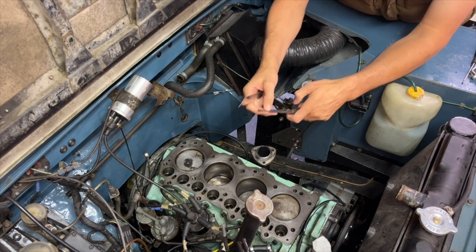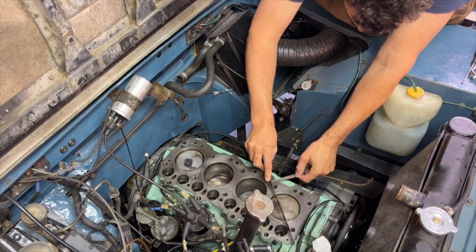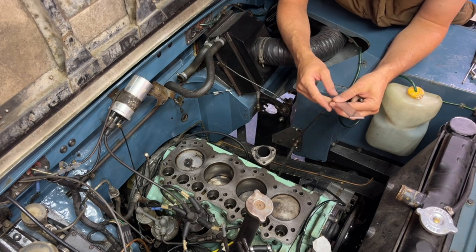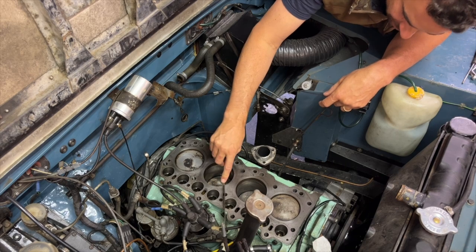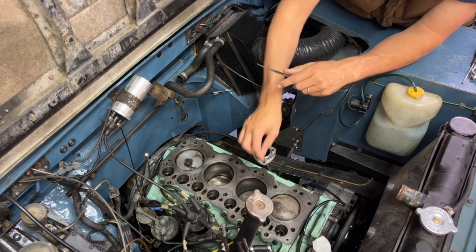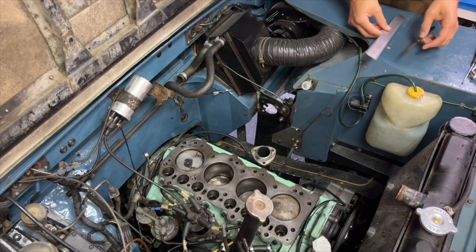And basically what I'm going to do is go along diagonally like this and check here for any warpage. I don't know what the tolerance is on this engine, so I guess that would be quite useful to know. I did just Google it, but I didn't find anything. But there will obviously be a tolerance on the cylinder head and on the block, I'm guessing. So, an acceptable amount of warpage, but I'm guessing that's very small. On other engines, on that method that one of my subscribers sent me, it was 0.006 inch acceptable warpage, which might be a good guide for this. So anyway, let me find the right feeler gauge setting and then I will get back to it.